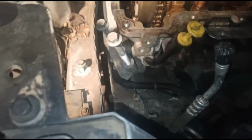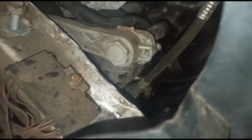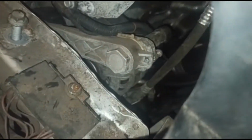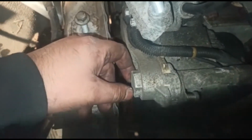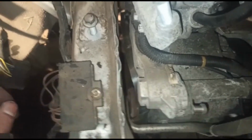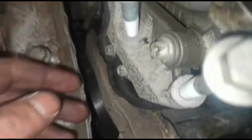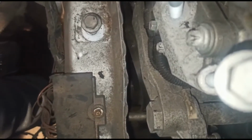So to reduce the tension on the serpentine belt, what I've done is this bracket here goes down to the tensioner. That's a 30mm nut end or whatever, which I've used to release the tension on the serpentine belt. So you can see it's all, well, you can see now. Yeah, so that's all loose.